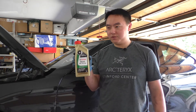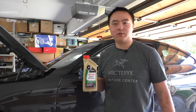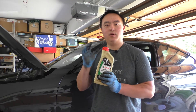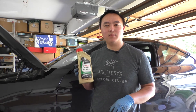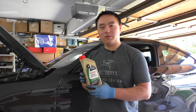Hey everyone, today we're going to show you how to bleed or change the brake fluid on your F2X, F3X, and F8X BMWs. For this particular car we're going to be putting in Castrol SRF because this car does see some track time. I really like SRF for the track because it has a very high wet boiling point, which means this fluid will perform the same over a longer period of time — in my own experience it lasts about 10 months before you start to see any drop off in performance, so almost a whole year.